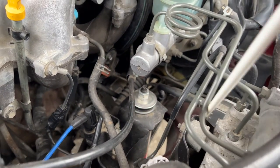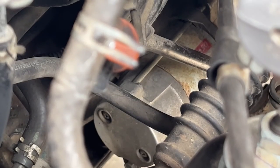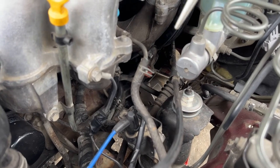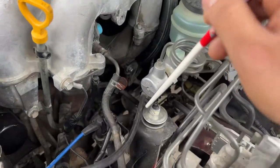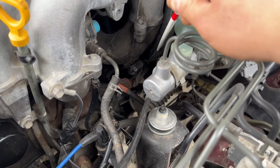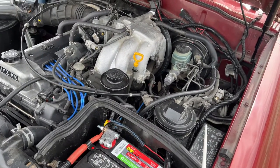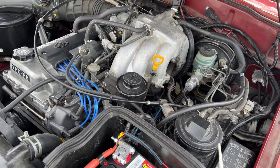If you were to remove your lower tire, right down there is where your starter is. So if you're having issues with your vehicle not starting, you can do the old method where you hit it with a hammer to get you by — but that's where your starter is. To access it, it's easier if you jack up the vehicle and remove the front tire. Also, if you want to access the pesky heater hose I talked about, you have to remove the front tire, jack it up, unbolt the transmission stick, and then you can access it — it's not that hard actually. So besides all of that, that's pretty much all the most important things. I might have missed a few hoses, but for the most part I wanted to mention the main things you will come in contact with.